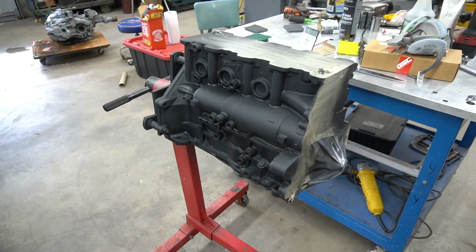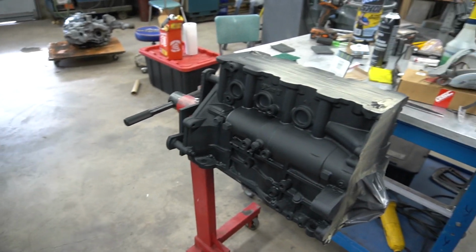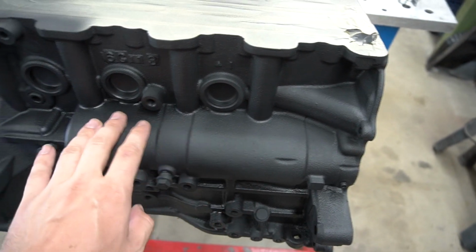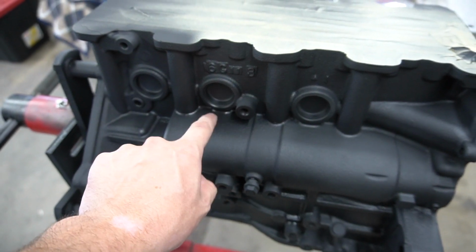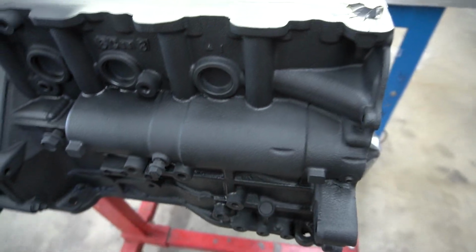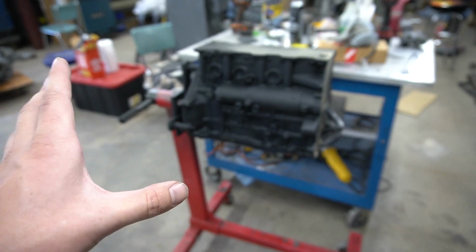It is a much more satin-like finish than I was expecting. I thought it was going to be more of a semi-gloss black, but it is not. It's essentially just Cerakote Blackjack. It's a little bit glossier here, but I think it's because it's a little bit thick there and it hasn't fully cured yet. But over here, it's fully cured, like you can touch it, tap it, it's fine. 5-day cure time on this, so I'm not going to be messing with it much until then.